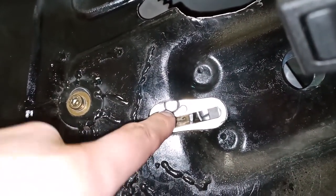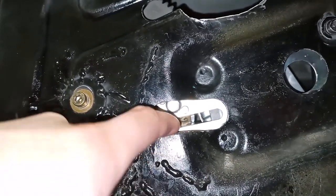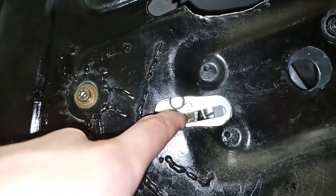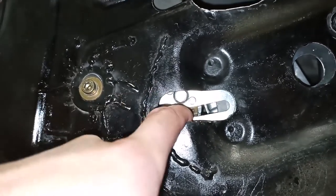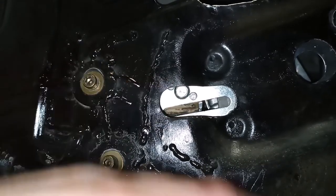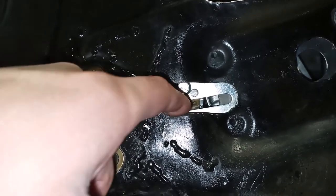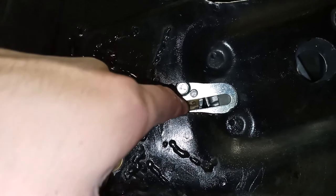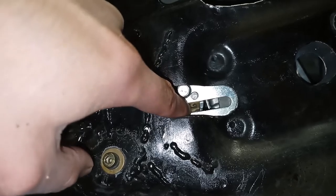On the coupes, you don't have much of an adjustment. If you recall, the plastic block that I sanded down is actually the end stop that limits the travel of the regulator and also the end of the glass as well. So in sanding the rubber block, I may have possibly made this block shorter, causing the glass itself hitting the top of the frame to be the limit stop.